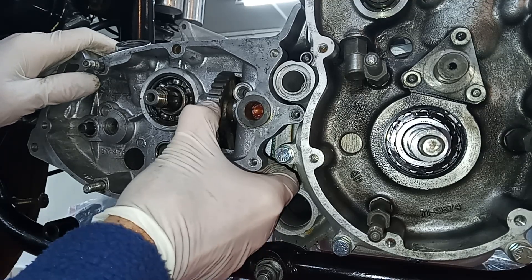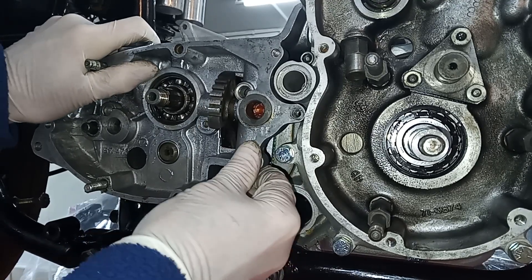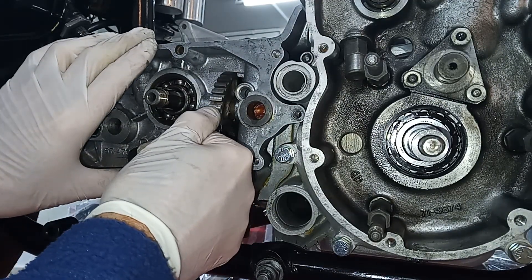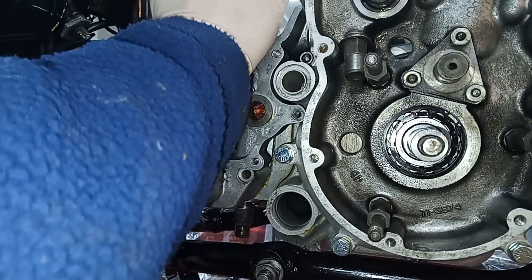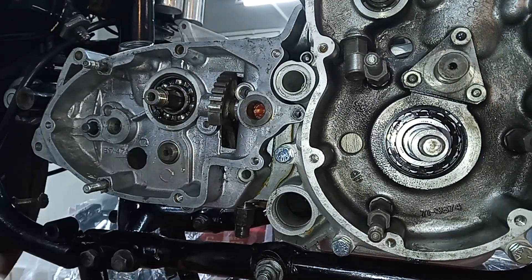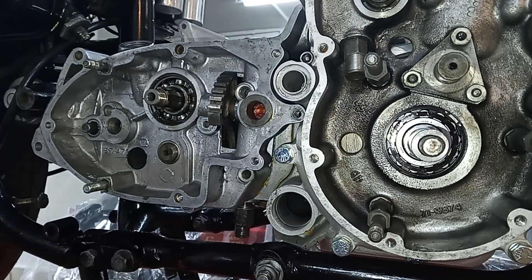We move it till the middle of that tooth is just basically just down, so the teeth can engage. And we should get that rocking sound — yes, that's it. They call that the second tooth, so the top of that tooth should line up there — that's it. Basically it's the first available tooth so that we get maximum travel. If it's fully down it doesn't engage and it just jams. That rocking tells us it's right. If we move it too far down to the next tooth there's not enough travel and you won't get fourth or fifth gear — that's the classic cause of not getting fourth or fifth.